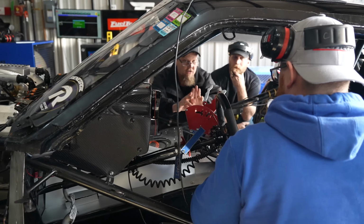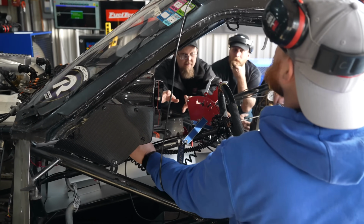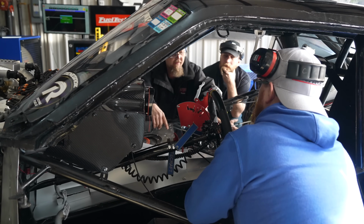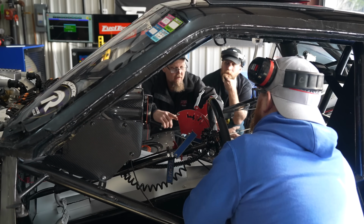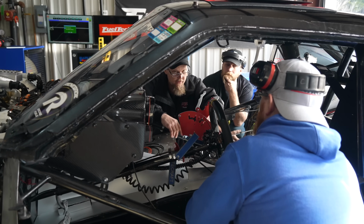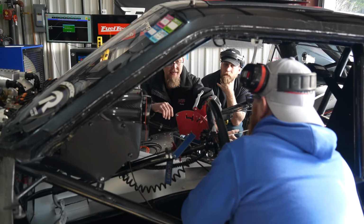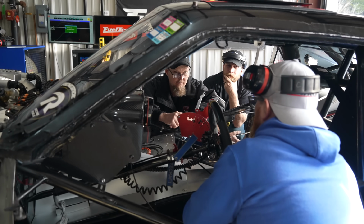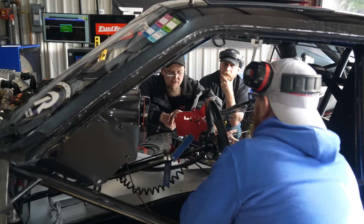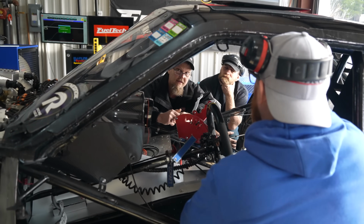Okay. There's only 3 wires hooked to the battery. The 2 from FuelTech, right? Mm-hmm. It's that and the FT Spark or whatever it had, the wiring harness that went back there, and then the power wire. The power wire goes to my disconnect. There's nothing else, and it cuts it off. So when we do this, that's dead. I don't have any power going anywhere. The only thing that bypasses this switch is FuelTech, because y'all said to hook it straight to the battery. So I did. Correct. But when we unplug the yellow outputs connector, it shut off. So there's something activating there. No, external to the ECU. It cannot come from here.